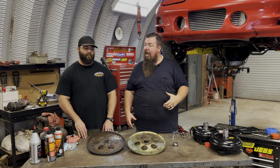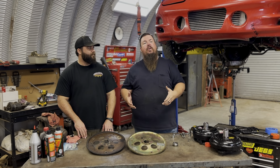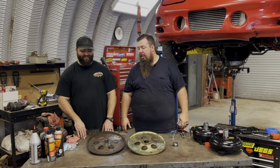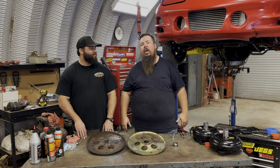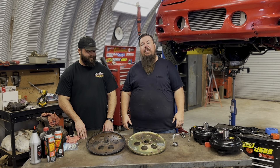When James first got here and we started putting the car on the lift, he was bringing all his boxes in for the torque converter swap. I noticed he had a thin white box that looked the same size as a flex plate. He informed me that they'd been going to the track using his factory flex plate, and he decided he was done playing games and likes his feet where they are. So he's stepping up to an SFI approved flex plate to go along with his upgraded torque converter because he's trying to catch that comma on that horsepower number.